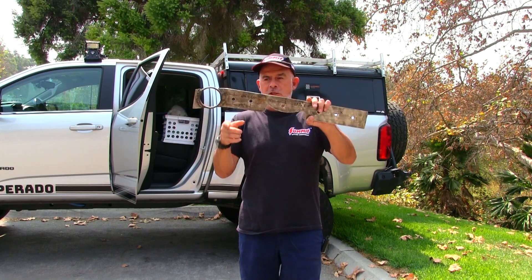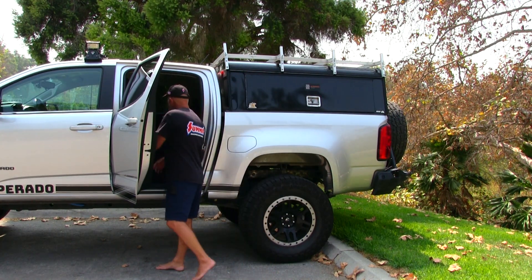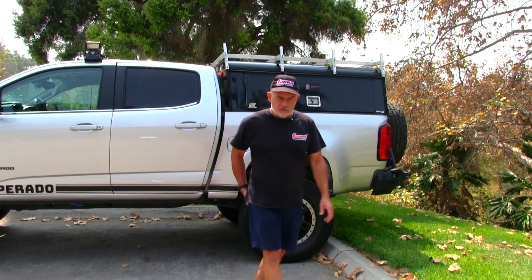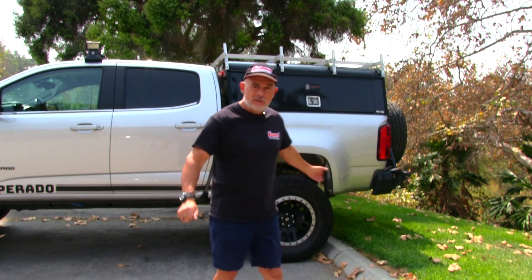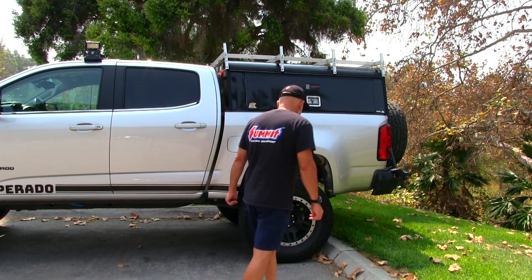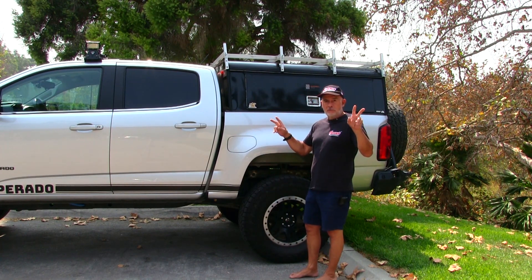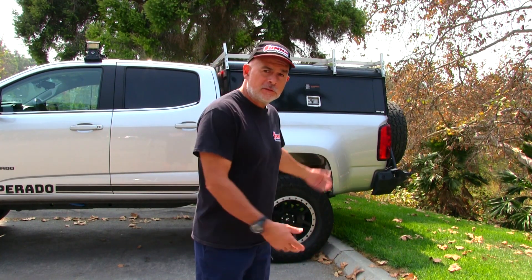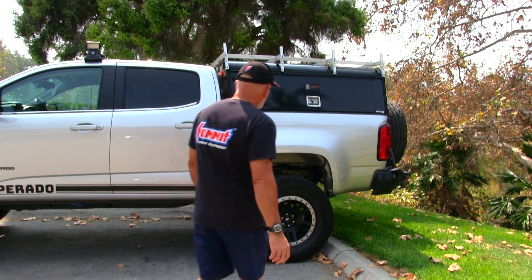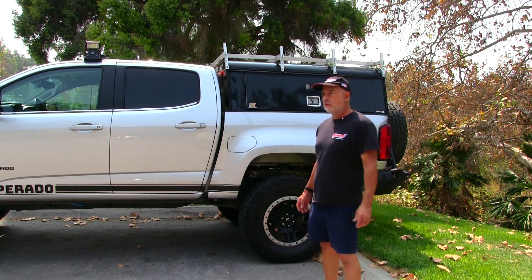There's no need to go further since it's kinking right there, because there are issues with over-plating too. One guy suggests that if you plate it too much you're just going to transfer that load somewhere else — the frame bends someplace else instead. I don't drive aggressively off-road because I can't afford damage. When I was younger I used to drive like a nut and broke everything — ball joints, diffs — so I try to be conservative now.